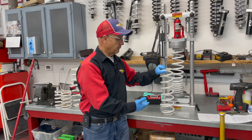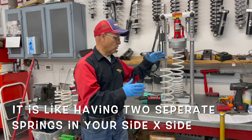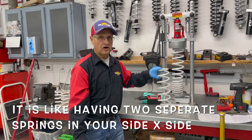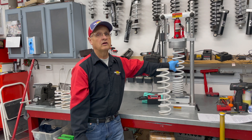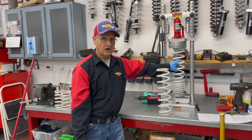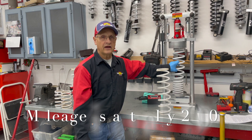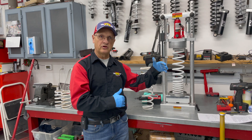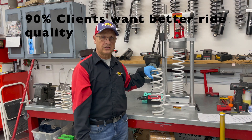The bottoming out is not what you want when you're hitting hard bumps — you want that suspension to be moving. In conclusion, the dual-rate spring kit versus the single rate gives you two worlds of different springs where from stock you only get one. Is a 200-pound stock spring bad on the rear of a two-seater? I don't consider that a bad spring. Is the 150-pound spring on the front? I feel that's gone weak — fronts are almost always heavier than the rears. This is about a three- to four-year-old vehicle with a little over 2,000 miles, and I have to believe this spring has gone weak. This should be a major improvement.